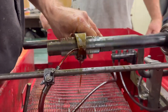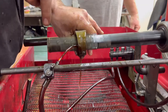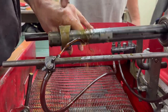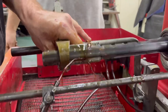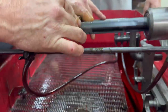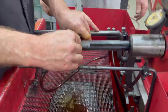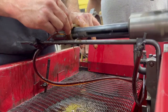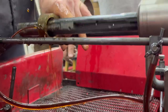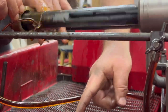Now, stroke it correctly. You're going to stroke about a quarter inch, not quite, maybe an eighth inch off either side. You have to use the full length of the stone, otherwise it'll wear out. And get your hand off of that and start honing. Get a feel for how much I can turn this. You're moving material, aren't you? Look at the stuff starting to come out of it.